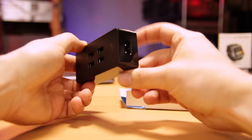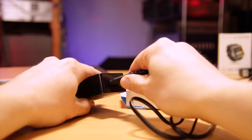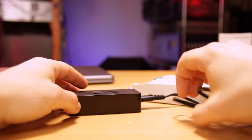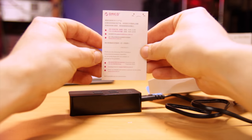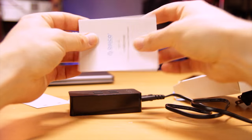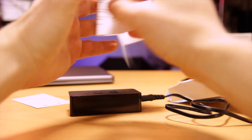It will provide 20 watts total across all ports, and each port has a fast charging capability at up to 2.4 amps, which is 12 watts apiece. Note that it therefore obviously won't give full charge current on more than one port at a time, but it can get close on two ports. It supports intelligent charging on all ports, which will provide current according to what a compatible device requests. For non-intelligent or broken devices, it promises overcurrent protection so that you don't have a device or cable meltdown.